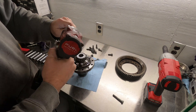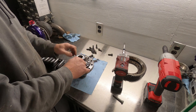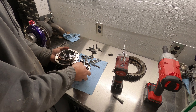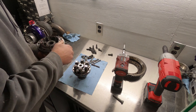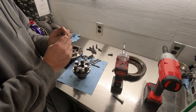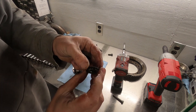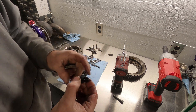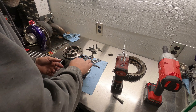I actually felt it come apart a little bit. There has to be a reason the bolts are on the top. There's the inside of your limited slip differential. I guess those are springs — it's very similar to the differentials I've had apart before. These are like flat washers, but they actually look like they're coned toward each other. This one is higher in the middle, and they put them together so the closed open ports face each other, which I guess creates a spring effect.